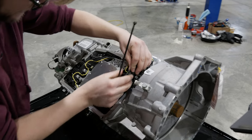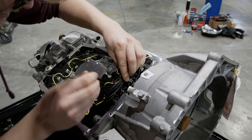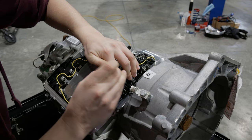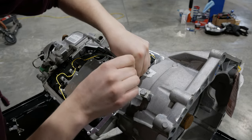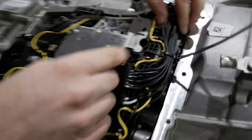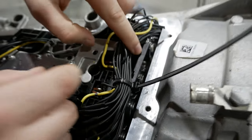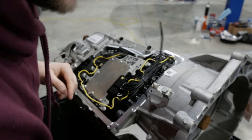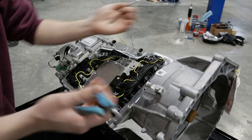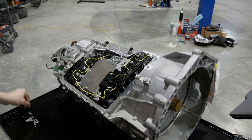I got my zip tie here, and we're being very delicate with the wires because we don't want to damage any of the solders. I'm trying to pull them tight and out of the way. We're going to zip tie them to the factory wiring shroud — it's like this plastic bridge. We're not going to make it that tight; we're just literally trying to hold it off a little bit. Cut the zip tie and spin it out of the way. The goal of all this is basically to make sure that no wires are able to push back toward the clutches. It's very hard to actually have that happen, but when we're doing a transmission for a customer, I like to make sure it's as perfect as possible because troubleshooting these is much harder than just building it right.